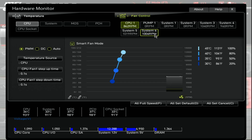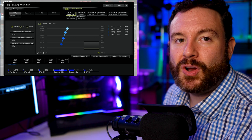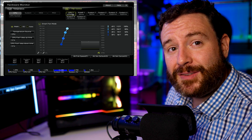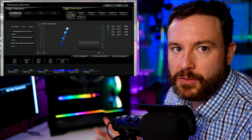I know I plugged my rear exhaust fan into System 6. The front three case fans are headers 3, 4, and 5, and CPU 1 is our exhaust fan. This is information you would gather as you're building the system, but you can also look on the motherboard — each header is labeled so you can figure out where things are connected. Some BIOSes actually have an identify function that will ramp the fan up so you can figure out which one it is without looking at the motherboard.